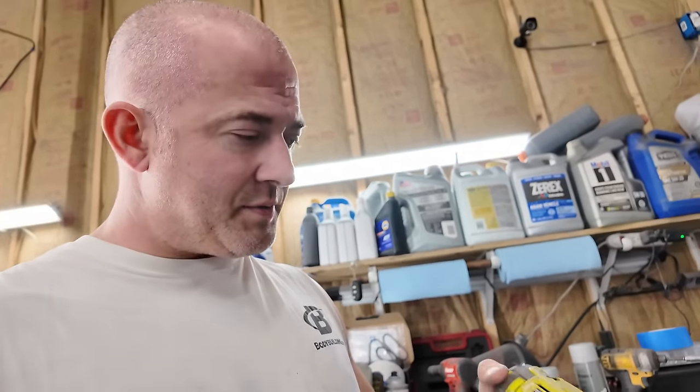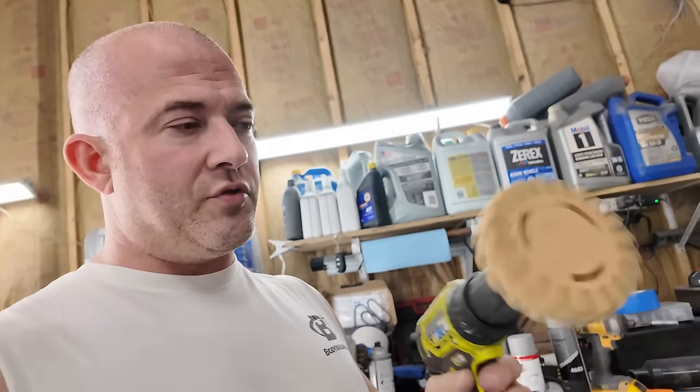I actually had it on a high speed, but I was only using half trigger. That's honestly slow speed. That's even too fast. You want to run it like that, and that's all the faster you want to run it. Because it'll get hot, because it's like a rubber compound or whatever. It'll get hot real quick, and it'll just melt your clear coat off. So do not sit in one place for too long. Don't push on it. Just easily run across it, and it'll just melt off there.